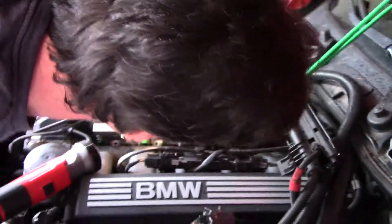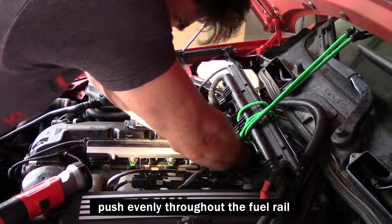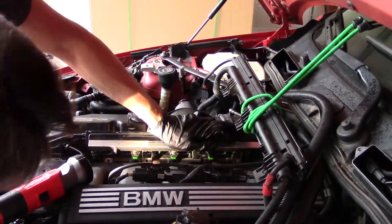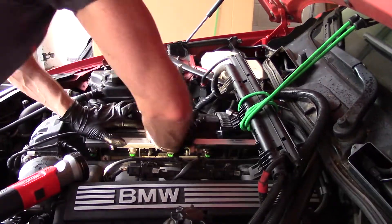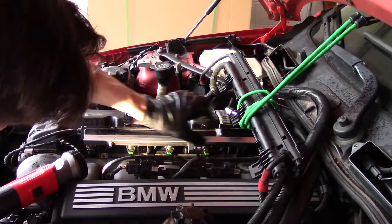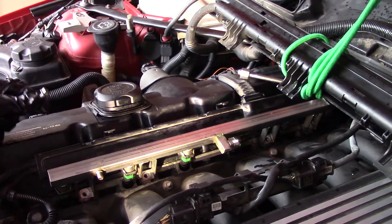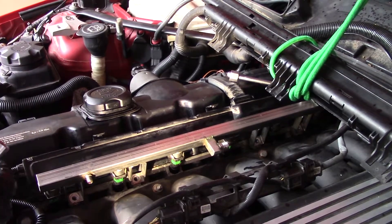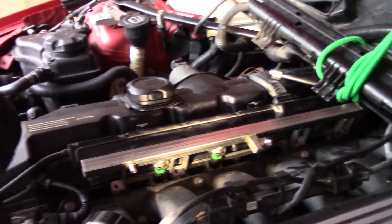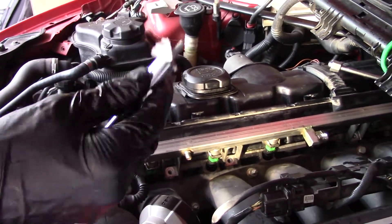Sorry YouTube. It was right inside — got it. Nice. It is rather tricky to get those bolts in. One trick we can use is to put a little paper towel on a bolt before putting it in a socket. Even though this is not a magnetic socket, now the bolt stays in place.